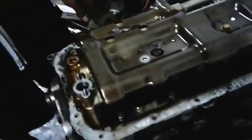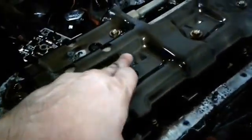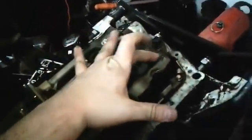Popping in here real quick — this is the H22 with the pan off now. You can see right here — hear that? Crunchy. Yeah, I hear crunchy. It's metal — this was a freshly rebuilt H22. There's a good amount of rust on the baffle right there. Hopefully the crank isn't too bad. Since we're not seeing many H22 cranks for sale, we are most likely going to take it to the machine shop and have it ground down, then go with some oversized bearings.